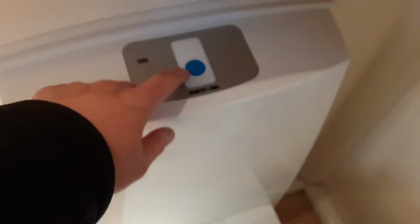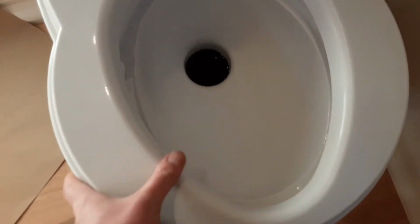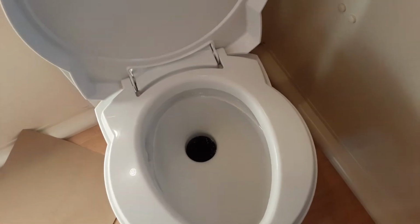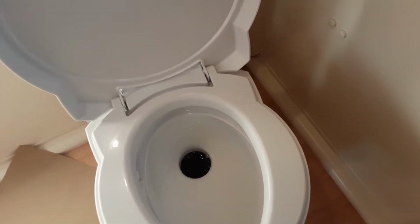And in the bathroom, one of the last things we're going to go through on this particular caravan is the toilet system itself. You've got an electric flush on the back here, as you can see. The toilet itself will actually need to be pointing straight towards the shower when you try and remove the cassette to empty it. If it isn't, it will actually stop you from removing the cassette due to the fact it's got a lock on there to stop that from happening. Essentially, it's to stop the cassette being removed while the toilet's been used.